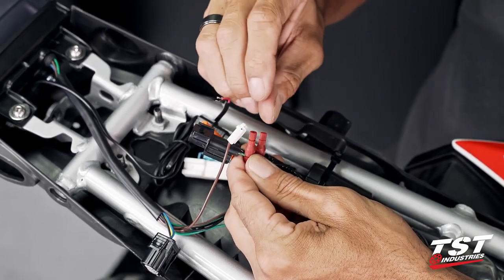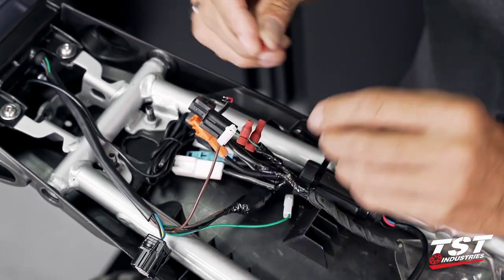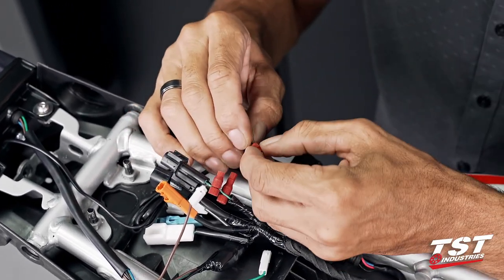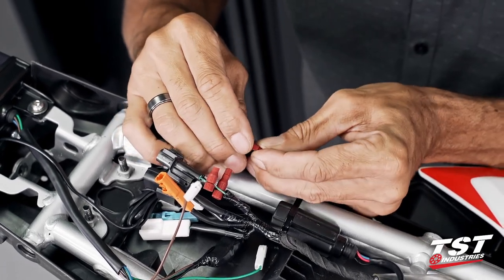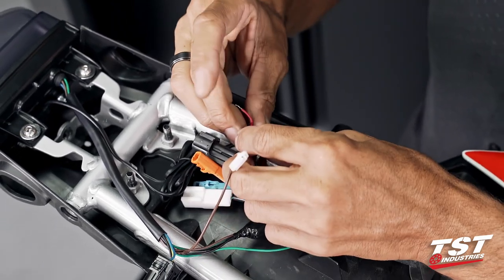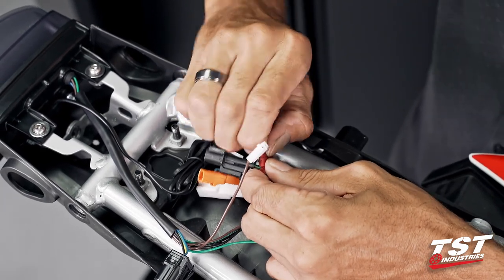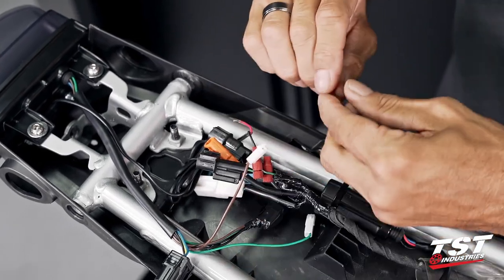Now, this is very cumbersome to handle. I like to remove it, hold it tightly. If you lose this, this whole connector is kind of useless, so careful. We'll get the stripped wire through from the grip portion towards the threaded portion and get that seated in here and tighten it down. If you've done this properly, you give it a little tug, should be good to go. Repeat the procedure on the other side.